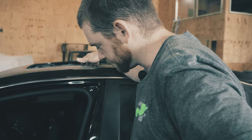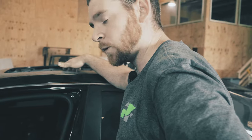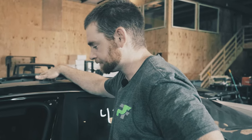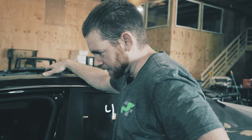Eventually we'll put a driveshaft hoop under the car. I had one at the rear end but didn't have one at the trans — we still need to put one in. Need to get some one-inch tube and a one-inch die to bend that so it fits nice and snug in the tunnel. Other than that, cage is getting pretty wrapped up.